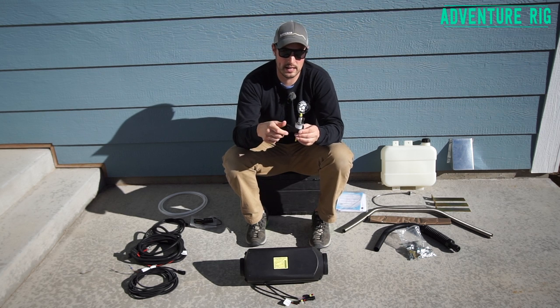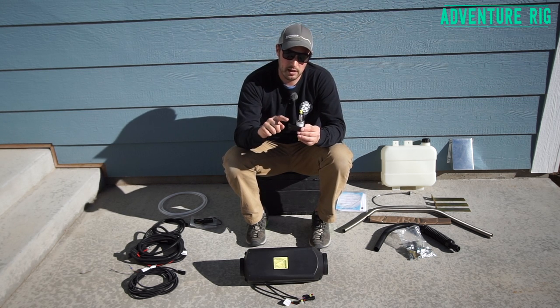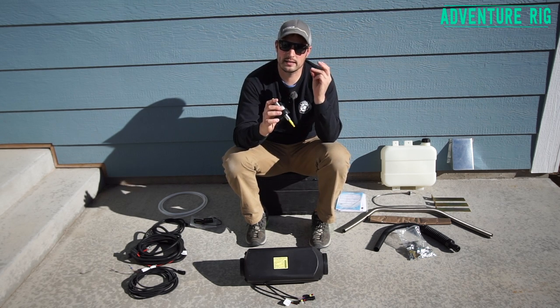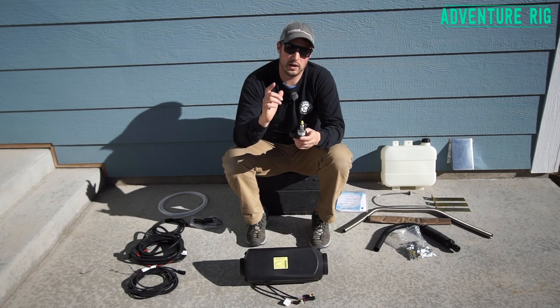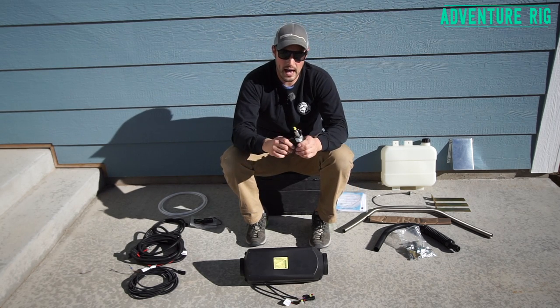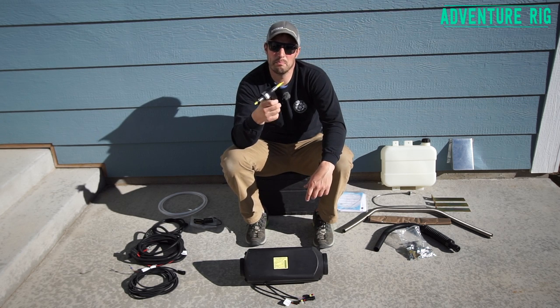The last one that they sent a few years ago was just a hose clamp, basically, that you then mounted into the mounting surface. Well, the problem is that this fuel pump just sits there and clicks as it's pressing the fuel through the line. So what happens is it reverberates through whatever surface you mount it to and goes up through the walls, down through the floor, however that may be. Well, where Callie and I put this was right underneath the bed.